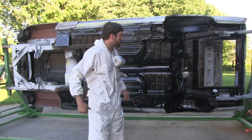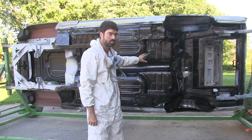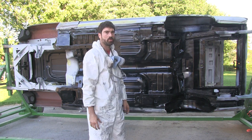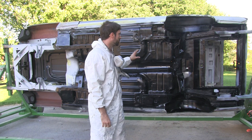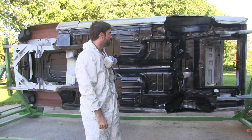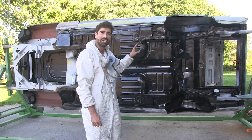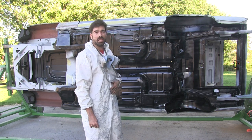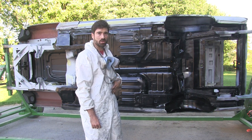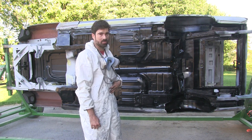First coat is done. I'm only doing one coat because I don't need a full coverage. It's already been covered well enough. This is just to bond the Raptor bed liner. It's going to chemically bond, which is the strongest possible adhesion you can get for that type of a product. The epoxy primer that I use is called Evotech. It's a product that's made in Quebec, and it's a really, really tough stuff. They use that on agricultural and industrial application. So that stuff is incredibly strong.